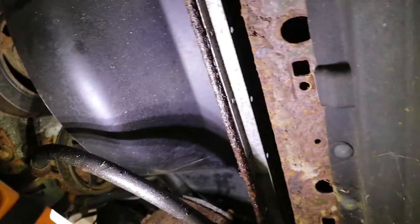A third good reason to do this: the odds are that everything is crusty in your rig if your lines look like that. If you were to go and try to replace with complete brand new lines and disconnect the fittings at the radiator where they connect, you may break it — you may break your radiator — and you don't want to have to replace your radiator. So by doing this with rubber, you're still keeping your lines there, just cutting them back, and you avoid any damage. This is the way to keep your rig going without making it a complete nightmare.